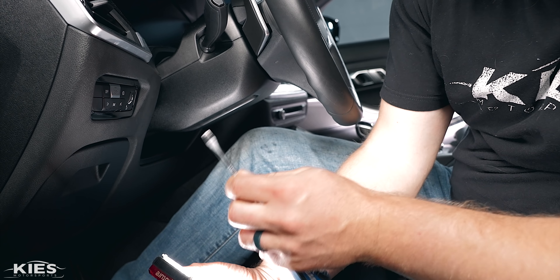Now that everything is finally installed and final torqued, look right here — we need to do a test. Start the car, put it in drive, and then you can just shift up and shift down. As long as it goes up when you upshift and down when you downshift, you're good. Standing still, it's only going to let you stay in M1 or M2 — it's not going to let you stay in third or fourth gear. As you just saw, it is a pretty easy process to upgrade your paddle shifters in your G20. If you're looking for the parts or any tools we used in today's video, see the links down below. My name is Brian, that's Zach behind the camera — thanks for watching, and we'll see you in the next video.